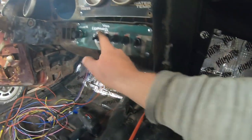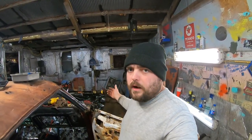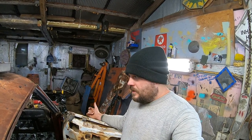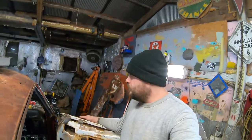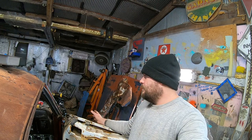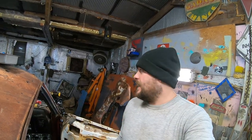All for about 30 bucks, let's figure in the wire. This is kind of what I'm getting at here, guys — it's low buck, low effort, and you can get this done in a few hours between lunch and dinner, and it will work reasonably well. If you've got overheating problems, go to your Pick-A-Part, go get a mid-'90s Taurus or Cougar, pop that sucker out — it's pretty much universal for muscle car era cars. Just zip tie the thing in there and see if it helps. It did hold up in a circle track car, but it looks terrible, so we'll do something better there. But in the meantime, we've got a functional fan, a functional switch panel, and half the lights we need. Progress.